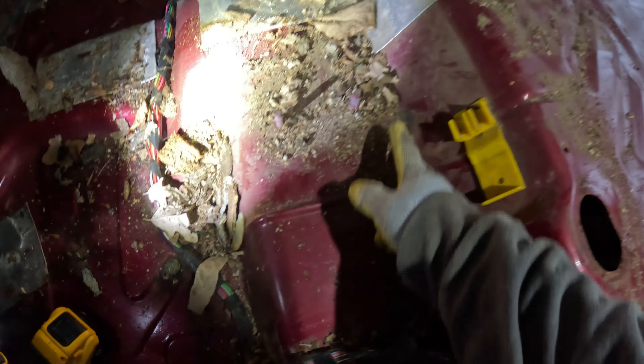At this point you can probably use a sawzall — be very aware of where these lines are and don't hit them. Well, the reality is this is all the more I need to go. I was figuring on pulling the whole sending unit out, but I've got a whole other fuel pump on the shelf. Rock Auto was running a sale and had a couple of cheap fuel pumps for explorers left — I bought the rest of them. I did find out something I was dreading: this is a return-style system. My 2000 Explorer is not return-style, but we can make it work.